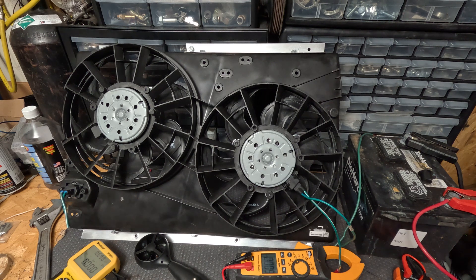We're not trying to keep these cars down to 180 — we just don't want them passing 230 in extreme conditions. It's going to take above 250 to hurt something in most cases. The condensation produced from combustion — you see a lot go out the tailpipe, but a lot also goes into the oil. It needs to reach a temperature to boil that off or it'll create a ton of sludge in the bottom of the oil pan. Eventually that sludge gets picked up by the oil pump and clogs oil passages. I feel like that's one reason engines in the 60s and 70s — similar 302s — didn't last very long. It was unusual to see 100,000 miles. They ran those cooler, but Ford intended these things to run 215-220 right around there.